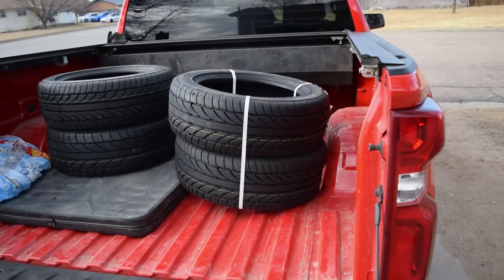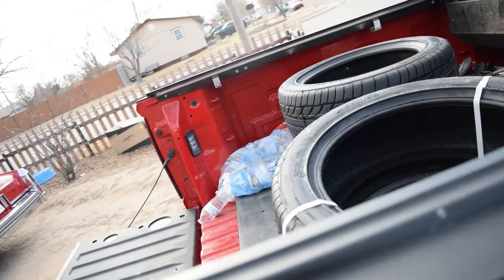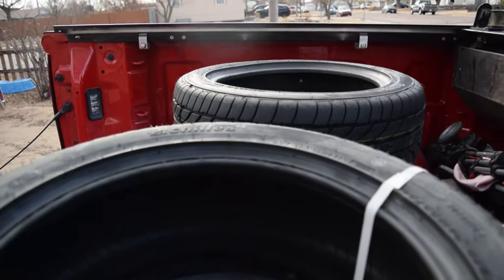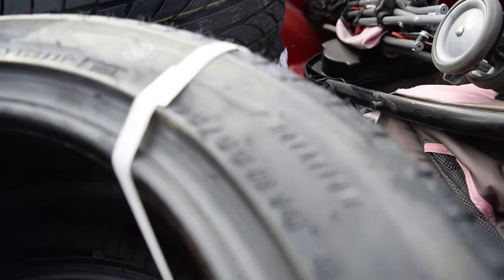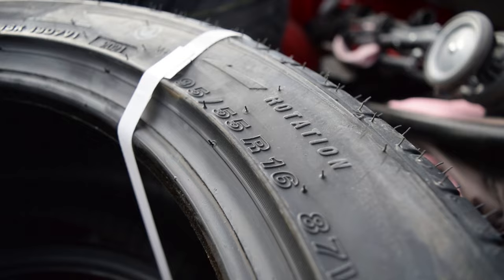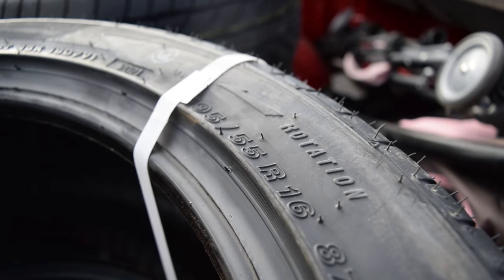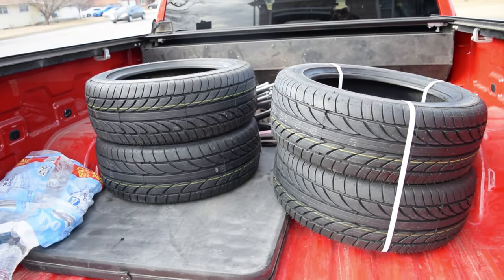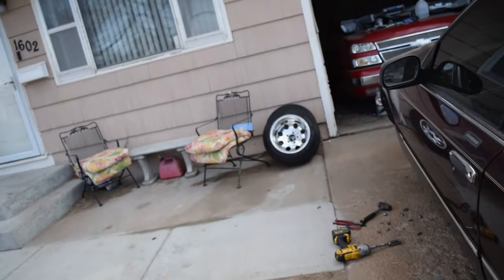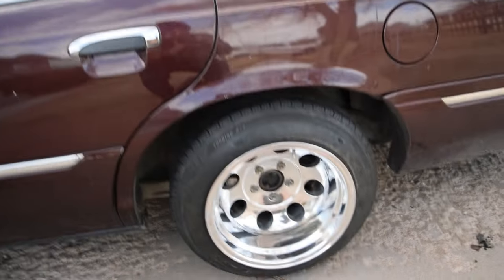So I had these tires, right? And I ordered 195/55R15 Achilles ATR Sports. And if you take a little gander here, as you can see, they are the wrong size. So shout out to tires.auto on eBay for giving it to me in the butt dry and sending me the wrong size tires, boys. But the good man Dwayne Rupp over at Rupp's Tires, he had these 195/60s in stock instead of the 195/55.